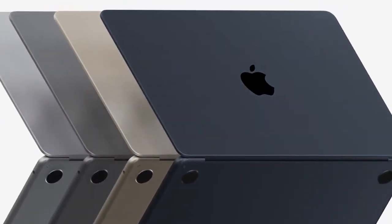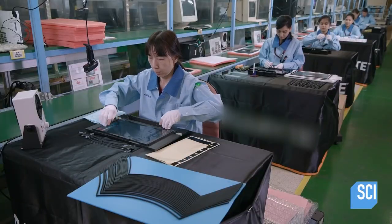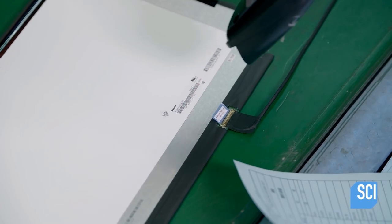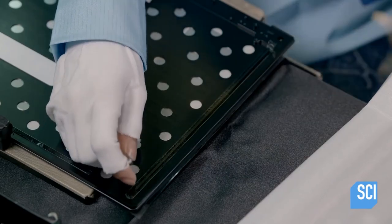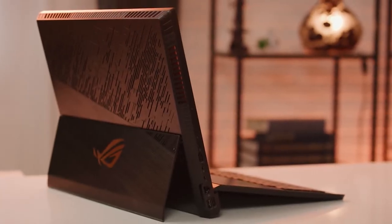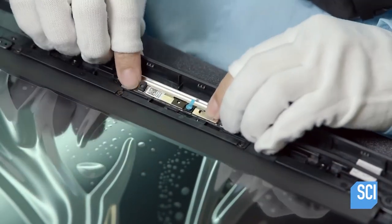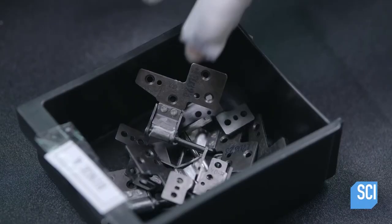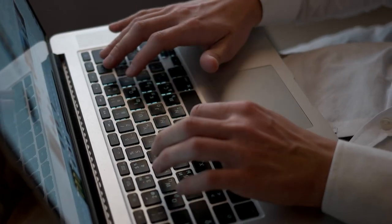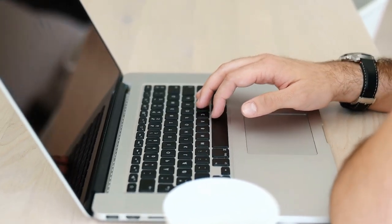The perfect finishing touch is a black margin at the bottom of the display screen. The next step is to manually assemble the panel kit — the top half of the laptop. Technicians place a protection film on the 15-inch LCD screen, then plug in the cable designed to connect the LCD to the motherboard. Once secured, the LCD screen is carefully inserted into a frame with a webcam and microphone already embedded. Technicians then attach the antenna bottom cover to the screen cover and the motherboard cable, followed by installing the webcam and microphone module and the two hinges connecting the panel to the rest of the laptop. The Wi-Fi antenna is installed on the antenna bottom cover, all components are concealed behind the antenna top cover, and finally a thin metal frame is embedded around the screen to complete the panel kit.